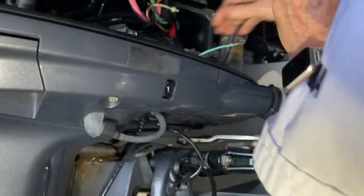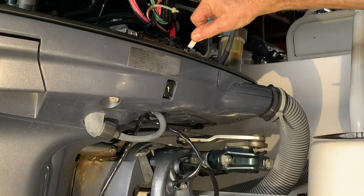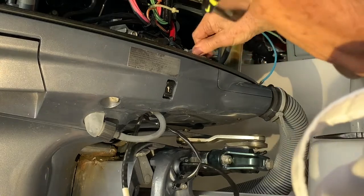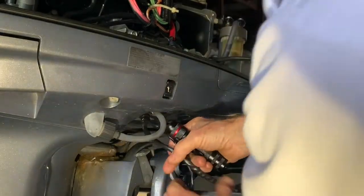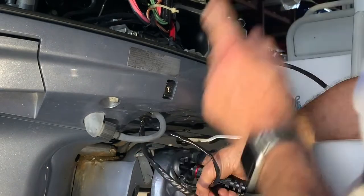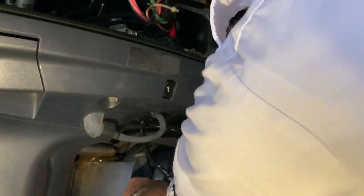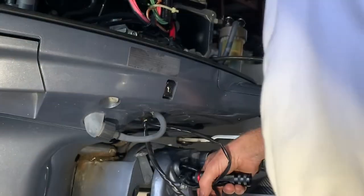And now we're gonna put this cable through the pan, the engine pan, through the grommet. Remember that grommet? How much am I gonna pull? Remember the white tape? Look at that. Up, up, up, the white tape, onto the grommet right there. So this is the length of the cable to the trim motor and the cable to your trim center, which is right here also. That white tape is where you should stop right here on the engine pan.